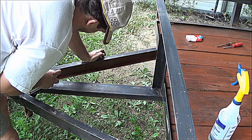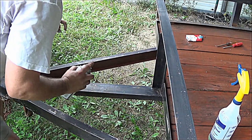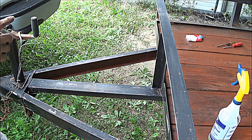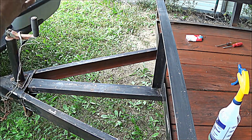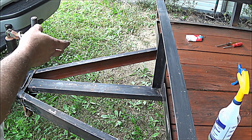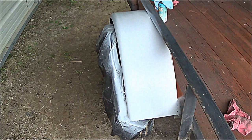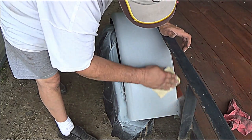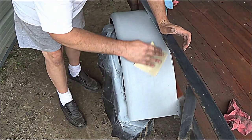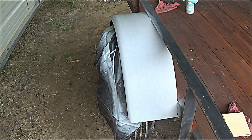I just went around the areas that are still pretty heavily rusted. The only way to really get stuff like that is with a sandblaster, but I don't want to go that far. I've neutralized the rust and I'm putting this rusty metal primer over that, then I'll put the paint over it. Before painting this fender here, I'm going to sand it down to give the paint something to bite into.